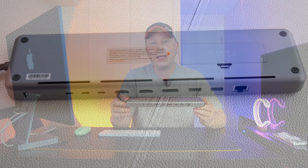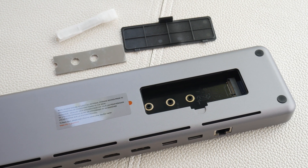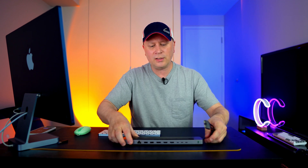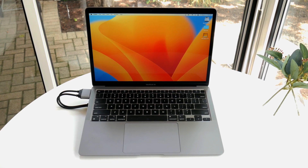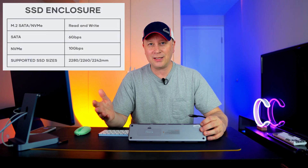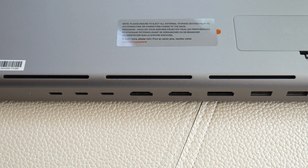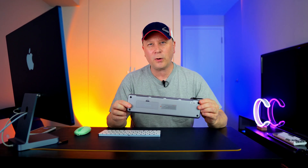On the back of it, this thing actually takes an M.2 SSD. A couple of other manufacturers released similar products and they ran really hot, but this one can take an NVMe drive — I'm going to test my WD SN770 from Western Digital. You can pop one in here for additional storage, so you don't need anything else on your desk. The setup is incredibly clean: when you have it on your desk with the SSD drive installed, there's literally nothing around you — all the wires come out the back so you don't even see them. You can also put in a SATA M.2, which I sometimes recommend because it avoids heat issues. But this unit actually has vents on both sides, so it vents heat very well. I've had very few problems with heat even running an NVMe drive.